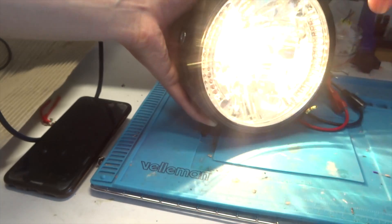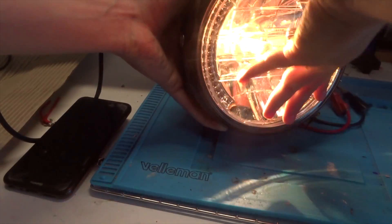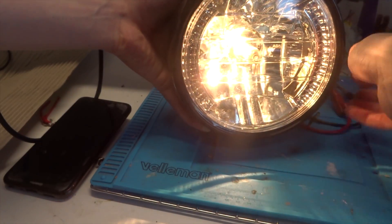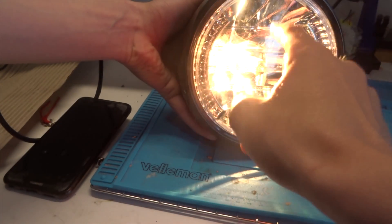That exact light doesn't fit my requirements because it doesn't have the e-mark. I checked with Andy Kirby and he said they do check that in the test, so it's important to have. It also means they don't check things like the colour or the angle for mirrors for the high beam stuff — they assume it's good if it's an e-mark, even if it's just a random stamp the manufacturer puts on. For comparison, this cheap one actually uses a filament bulb — it's so inefficient and not even that bright, and the high and low beam is just different brightnesses. This is definitely going in the bin.